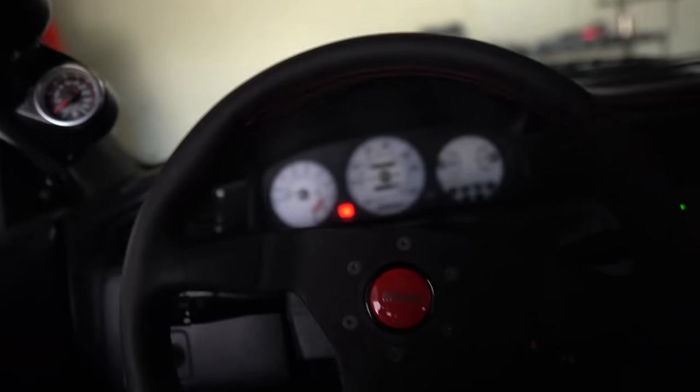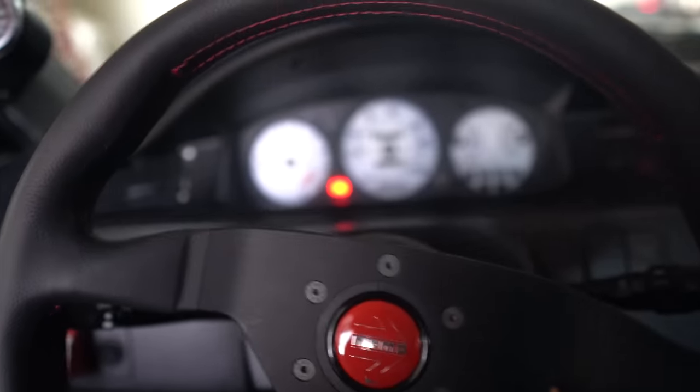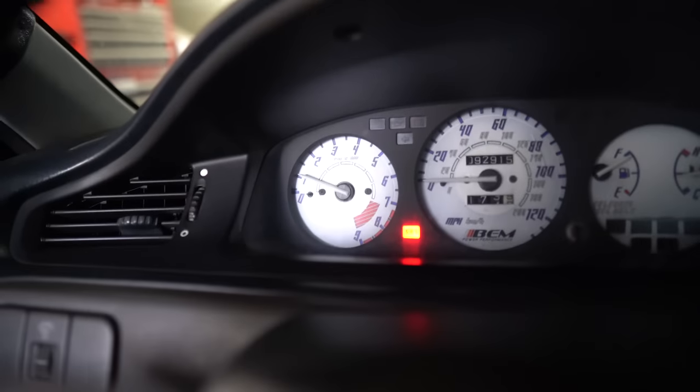I didn't get very far, but the car is still doing that really weird idle it was doing two videos ago on the way back from Rudd's Racing — surging and dropping. I don't know exactly why. I'm going to see if anything's going on with the ethanol content sensor in the tune. Now it's fine — it's like when I clutch in right away, it just can't hold itself at idle. It's about to die. I can assure you this is not from the coil and plug conversion — this was already happening before I installed it.